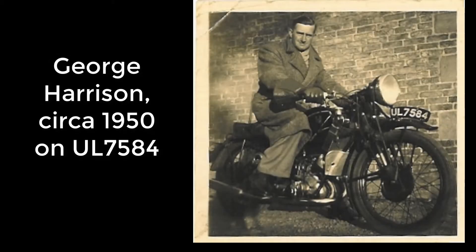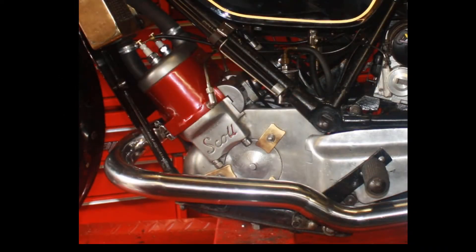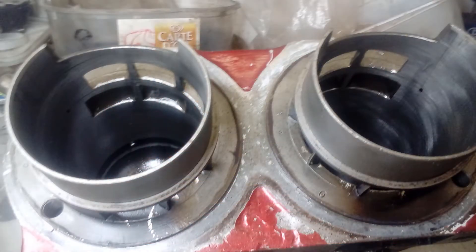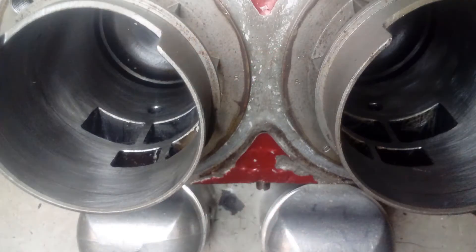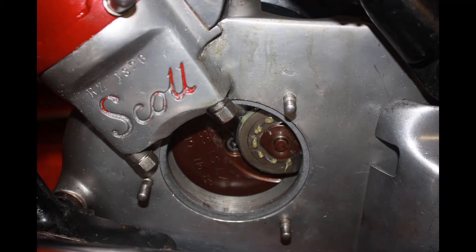This is my grandfather's 1929 TT replica — Leon's great-grandfather's — the one that started it all for us. We've just done a top-end rebuild this winter on this engine because it was getting rather worn. We did the full bottom-end rebuild including new moss cranks about three or four years ago. So all we did this winter is we pulled the barrels off, re-bored it, made new pistons — which we do in-house — you can buy those on our website.